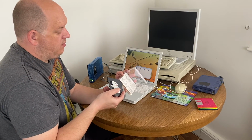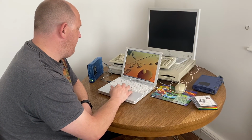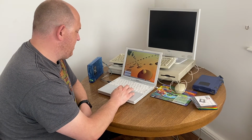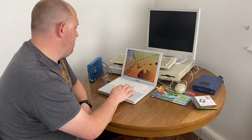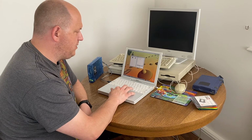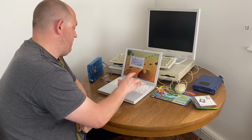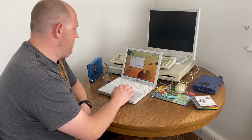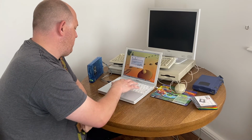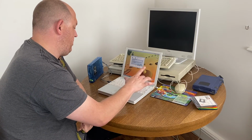I might be able to show you networking. So I have no Ethernet cables plugged in currently, but I have Airport, and I'm connected to my RetroNet. So if I go to the chooser now and go to Apple Share, I don't see a server listed, but if I put the right IP address in, that would help. 192.168.0.149. There we go.